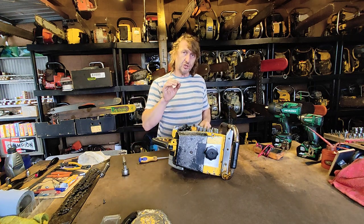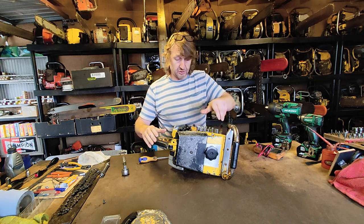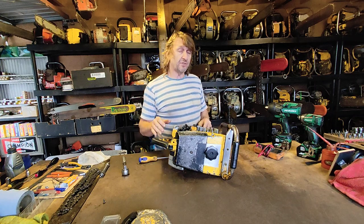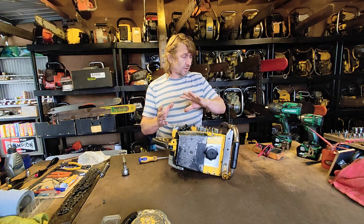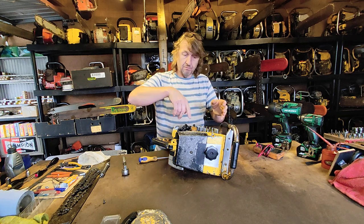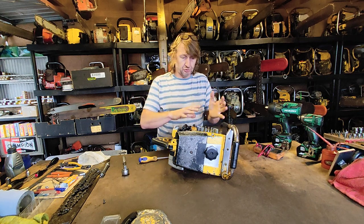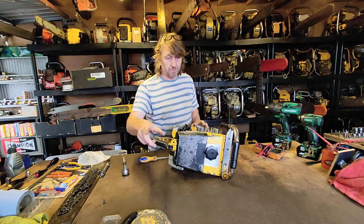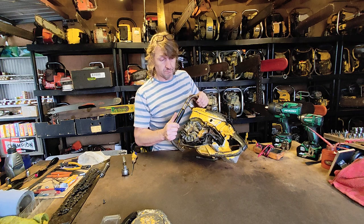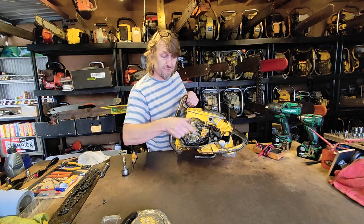But if you wish to use it as a turning tool to help you diagnose something, which in this case I'm going to hopefully use it to spin the engine, we definitely don't want the hammer functioning. And for that, you're going to need a bigger gun with more torque that we can electronically ramp up, and it will just overcome the internal resistance of rotating without using the hammer effect. So we're not trying to undo anything, but we have the pull cover off and we want to diagnose it. Okay. Here we are then, little flywheel governor here, as the revs ramp up.